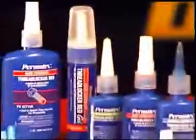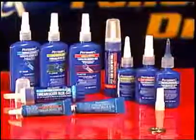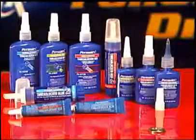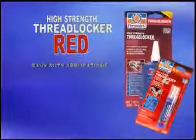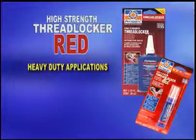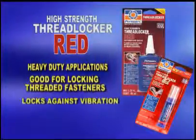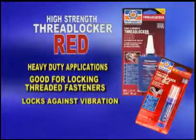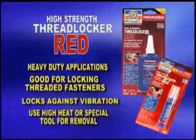Permatex thread lockers come in different grades for different applications. Choosing the right thread locker is often as easy as picking the right color. Permatex High Strength Thread Locker Red is a high-strength thread locker for heavy-duty applications. It's especially well-suited for permanently locking threaded fasteners. High Strength Thread Locker Red locks fasteners against vibration loosening, but requires heat or special tools for removal.